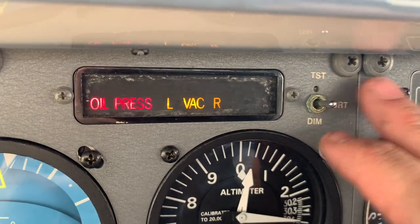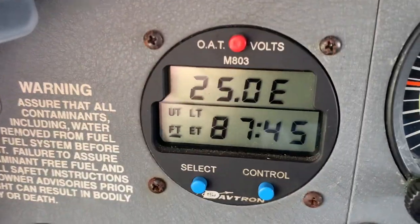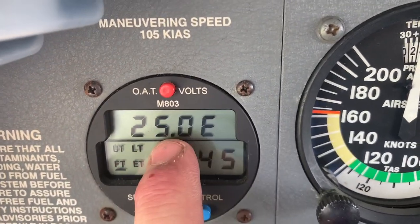All right, we're about to run it. That fault's right there — that was the issue before that was going off. And then when we checked our voltage, we've got 25 going to it right now. The alternator was putting out 23, so it was charging the battery but it wasn't keeping it topped off. So let's start it and see what we got.